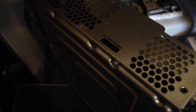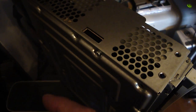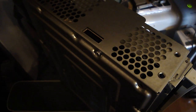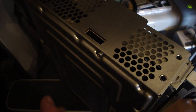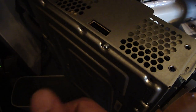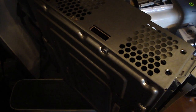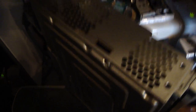It might take a little bit of tweaking to get it to work right, especially with the GPU. If you don't get that one right, you're going to have a good screen and then it'll start glitching out, or it might look nice at the beginning and then suddenly start to look as if somebody's putting a magnifying glass or a degaussing device over it — it'll just start to fade out. It's not a big deal — just go back, make your adjustments on the board, put it back in, and with a little tweaking you'll get your 360 up and running.